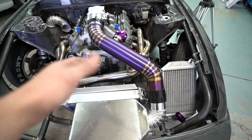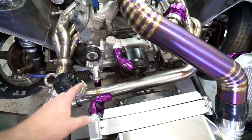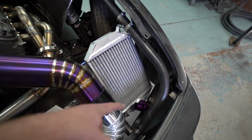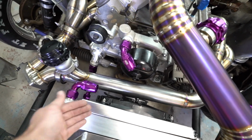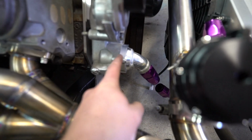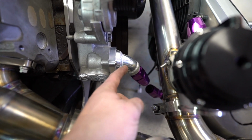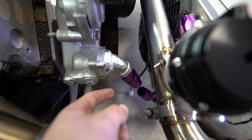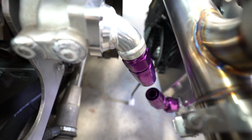Before we start measuring and cutting the hose for the coolant lines on the RX-7, I just wanted to show you guys the setup. I don't know if I explained this earlier, but this is the outlet on this pump. It's going to pump out over to here to the top side of the smaller radiator, come down to the bottom, come back up to the top side of the bigger radiator, flow through this way and then back down and back up to where the thermostat housing is. And as you guys can see, I was talking to you earlier about getting this milled down so we had more room here, because there was not a lot of room for the pump, and I actually didn't have enough room to put a 45 fitting on this, so I had to weld a hard 45-degree bend on there, so that we have this nice angle right there, and just a little bit of piece of straight hose and we should be all good to go.